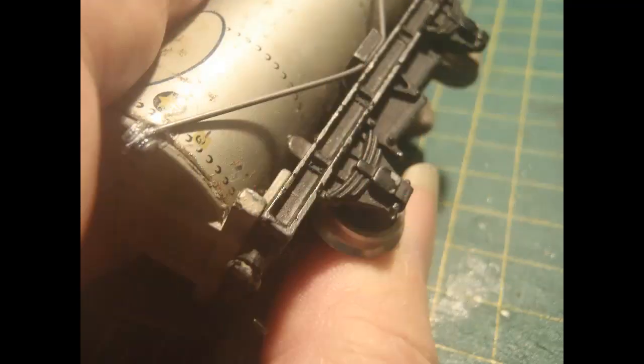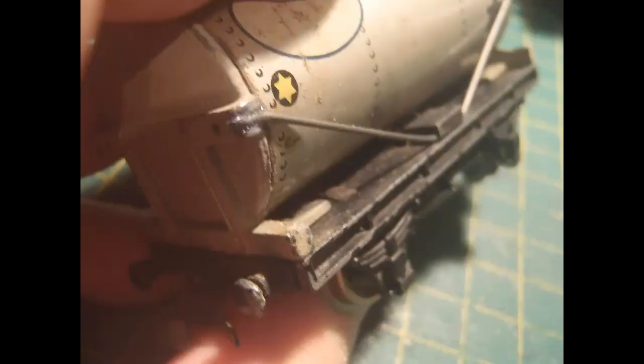Here the bearing has been reinserted and the bottom is correctly hooked over the axle box, but the tab hasn't been bent down yet and can be seen protruding above the chassis. And here the tab is bent down, securing the bearing and axle in place.